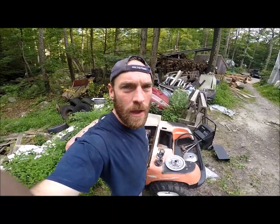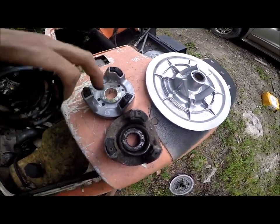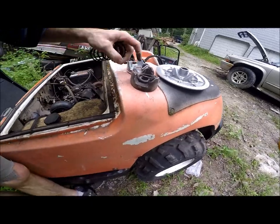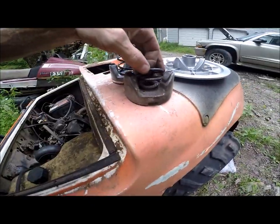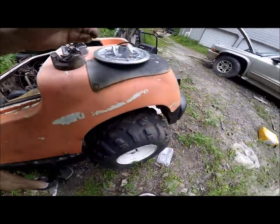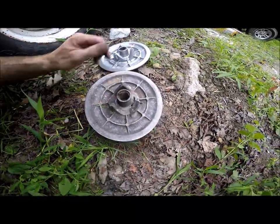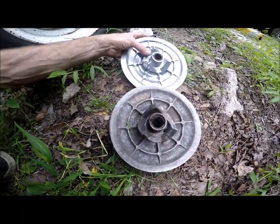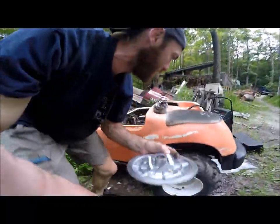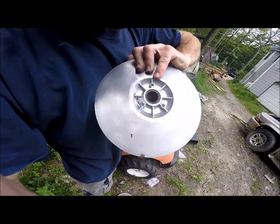I found something very technical I want to share with you. While putting this little helix together I noticed it had a set of numbers: one, two, three, and four. The spring has different spots you could put it in depending on what this clutch needs to do. Luckily the old one, even though it had broken, shows me that this one was set to position number three — so I need to be in number three on this side. The other side has A, B, and C marked on it, and matching that to the old clutch shows the spring ran between A and B on this particular model. Hopefully that'll help if you're trying to look that up.